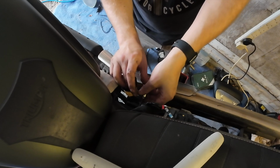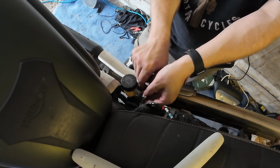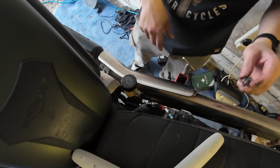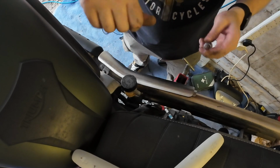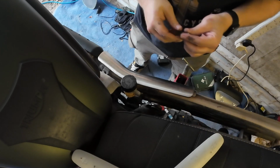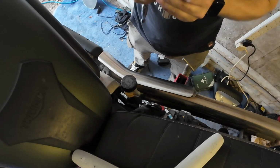Okay, I suppose you don't really need to service this thing, so you shouldn't really have to take this off, so yeah, red Loctite makes sense. But I've had it before where there's red Loctite in the bar end weights on my old Scrambler, and the bolt head for it was like a 3mm Allen bolt, and it just turned to cheese. It was not fun. So I was like, why? Most people add accessories on the bar ends. Why put red Loctite on it?